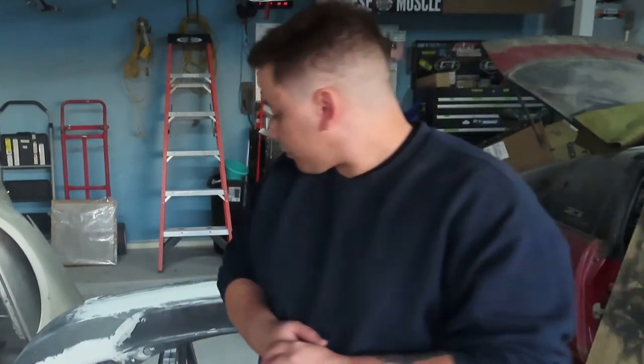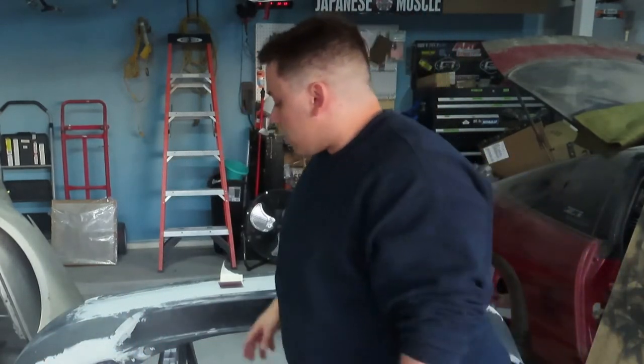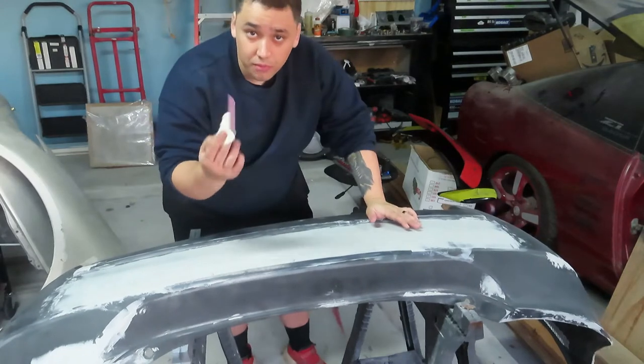So what we're doing — I'm going to be sanding the bumper, getting rid of the excess bondo that I laid on there, and shaping up the bumper to make it nice and smooth. When you put your hand across there shouldn't be any bumps, because when you do paint it the paint doesn't look wavy — it will show in the paint. It's kind of the same process we did with the front bumper, but I didn't show you guys much of that. I'm saving that for the big finale when the bumper is fully done, painted, and installed on the car.